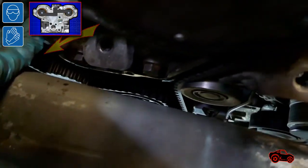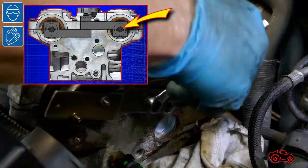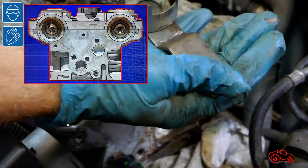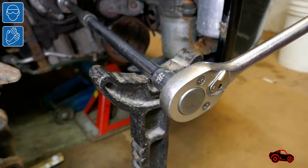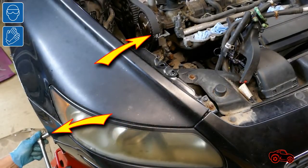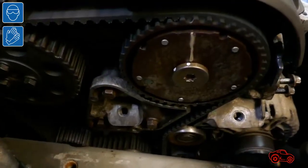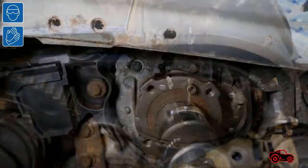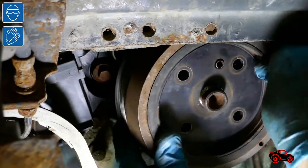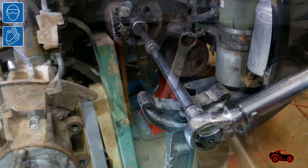I inserted my hand to press on the belt and test the tensioner. All the marks were aligned, so I removed the camshaft locking tool. I rotated the crankshaft two full turns. When the turns were completed, I checked the camshaft sprocket marks with the upper cover installed, as well as the crankshaft timing marks. Moments after, I refitted to specs the bolts and the nut of the crankshaft pulley.